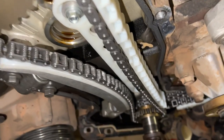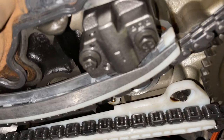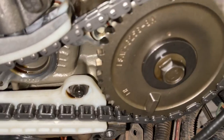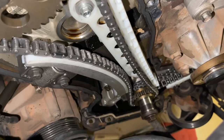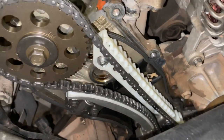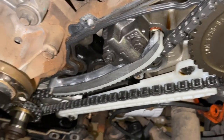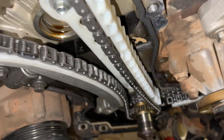So everything's in place. Please check the video description for the full repair - this is the timing chain tensioner lever arm portion of it. Hopefully you enjoyed the video. Please subscribe to the channel if you're new. Also remember at this point there is no oil pressure in the tensioners. So as you rotate the crank, everything should line up - make sure you're not hitting any valves as you rotate the engine by hand. Keep in mind that the tensioners won't have their full pressure on them right now. Also remember that as you rotate the engine, those master links will not line up with the dots every single time - so don't get concerned if you go around one revolution and the timing is no longer lining up dot to dot. Anyway, thanks for watching, and stay tuned for the next video.